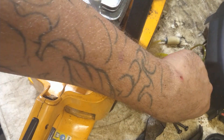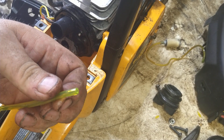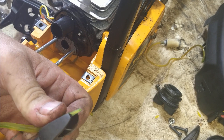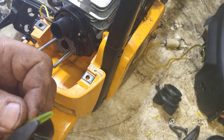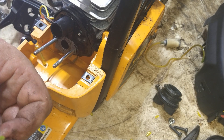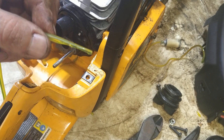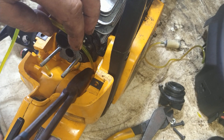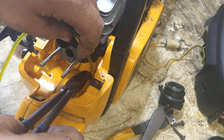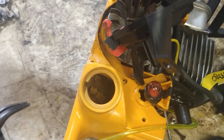Now get the thick line and cut it into a point the same way — about an inch down — it just makes it easier to grab. You've got plenty of fuel line in this kit; they give you enough to do this job twice. Feed it all the way down into that hole in the back of the tank.